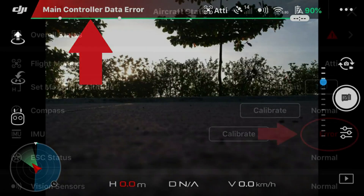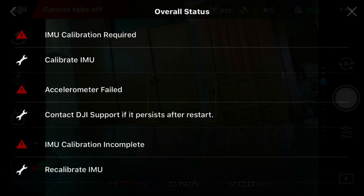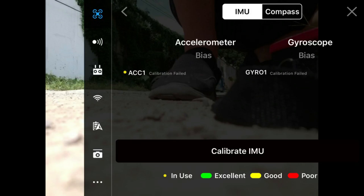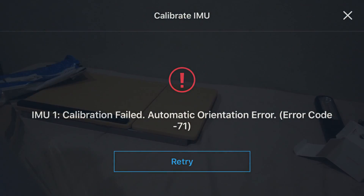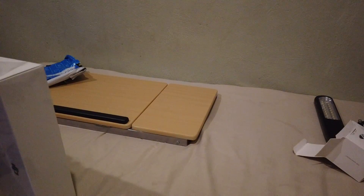This Spark was not going to fly anywhere. I clicked the status and it showed an IMU error — I needed to calibrate. I started the IMU calibration and it just hung after about 15 seconds, stopping about a quarter of the way across the progress bar. It failed with error 71, shown on the screen. It didn't get through step one of six. I tried many, many times and it failed every time with the same error message.